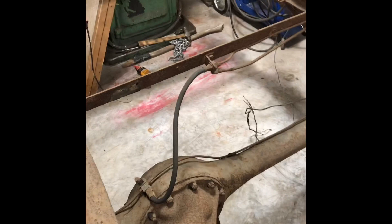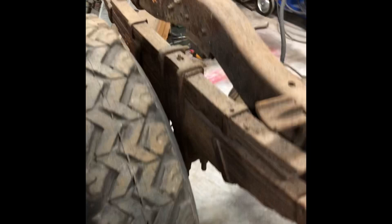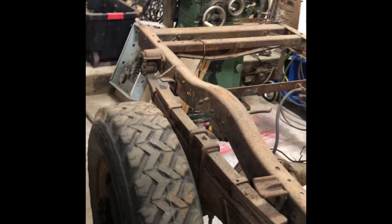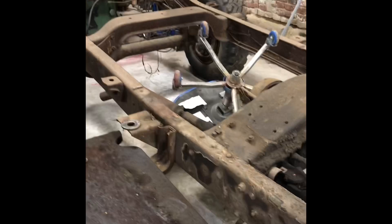You've got an assortment of fuel lines and brake lines that are hydraulic — I believe these are hydraulically powered brakes. These are the old brake shoe drum style brakes as opposed to more modern disc brakes. You can see all the suspension and the springs. These are actually really built up from what the original spec on this truck was — I guess they were using it as a dump truck or heavy hauler at some point, so they just threw a ton of leaf springs in there.